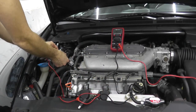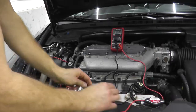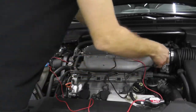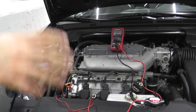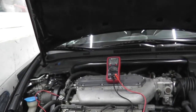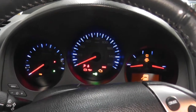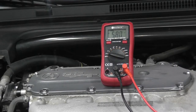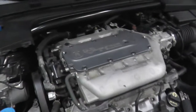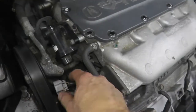Let's see how this all turns out — hooking up red to red, and finding a good ground. Now we're going to turn on the ignition key. What we want to look for is roughly 5 volts on the multimeter. We are not starting the vehicle, just turning the ignition key on. And there we go — we have 5 volts worth of power.